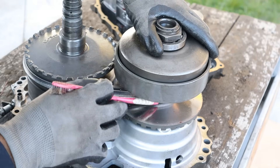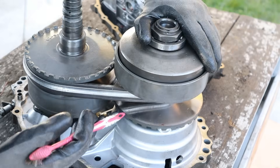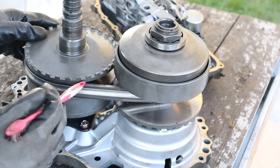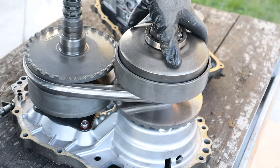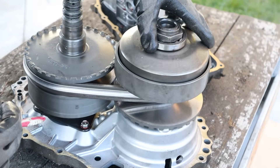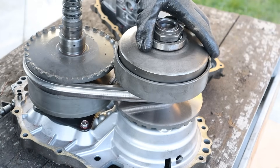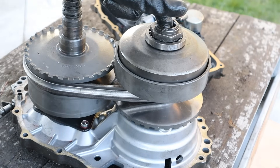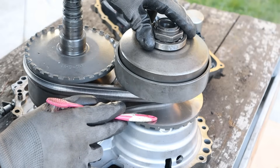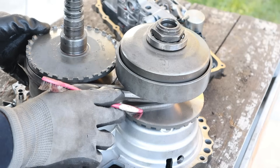The way this works is we've got this cone surface that allows this belt to ride up and down to achieve different ratios. With a small diameter on the input and a large diameter on the output — where the belt is riding on the outside diameter — lots of turns on the input gives you smaller turns on the output, but a multiplication of torque. That's great if you just want to take off from a stop sign in IMA mode. As you speed up, fluid pressure is applied down the shaft, filling this piston, which squishes it together and allows the belt to ride out a little further for a more even gear ratio — good for cruising on the highway. While you're pushing the primary side, you're relaxing the secondary side, allowing the belt to move in.